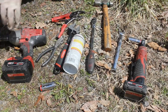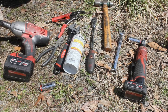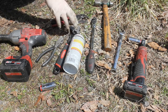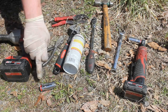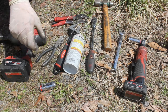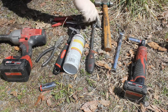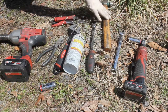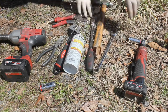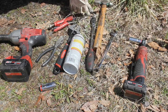Here are the tools you'll use for today's project. You can use a breaker bar — you don't have to have an impact — but a 19mm socket, a pair of vice grips, a pair of dikes or side cutters. I used a 12-inch crescent wrench and an 18mm socket. In the video I think I call one nut a 19, but it's actually an 18, and the new nut that comes with it is a 19, so keep that in mind. A 3/8 ratchet, a big hammer, a 19mm combination wrench, and a 19mm socket — a regular 3/8 ratchet will work. Also a jack and jack stand.